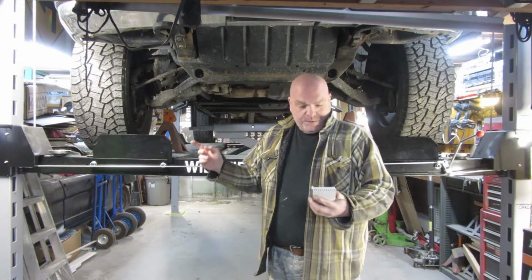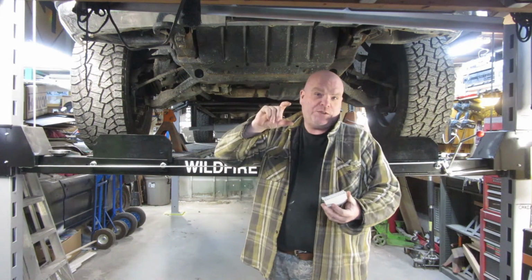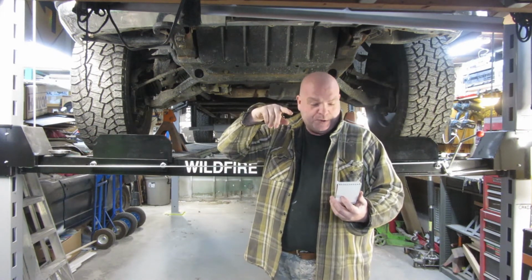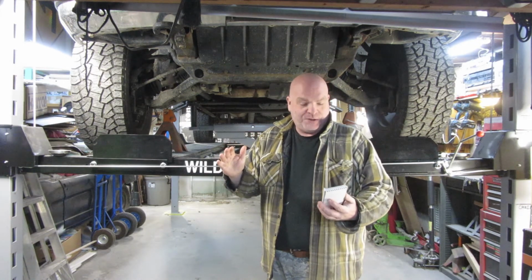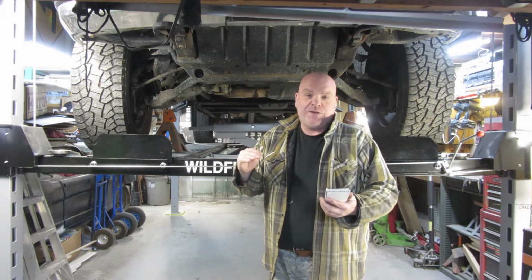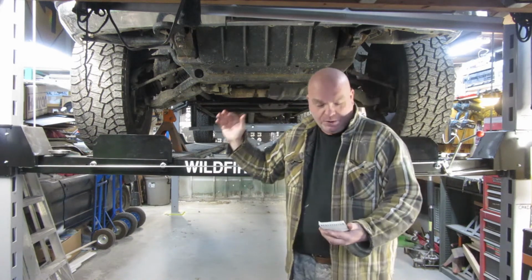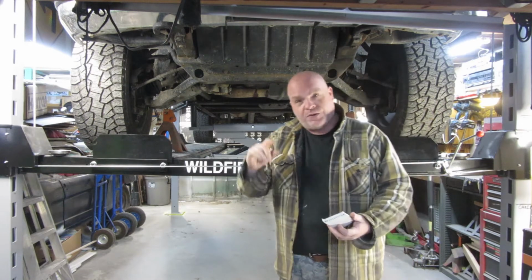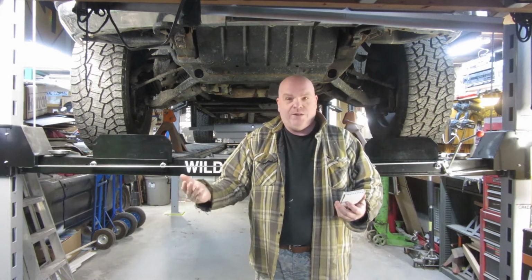From the floor up to the pillar, plus you need a couple inches of thread for the lock nuts up there, I'm going to go ahead and say 8 feet 9 inches. It's a little bit shorter than that, but 8 feet 9 inches should more than cover the height you need to be able to push this out a door. On top of that, you do have the wheels, which is going to bring it up another couple inches. So yet again, I would say you need at least a 9-foot door.